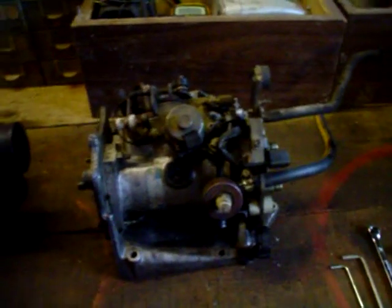The basic concept of tuning is to increase your fueling from your pump and to increase your boost pressure from the turbo. By standard you're probably producing 12 to 13 psi. When you start tuning it, you're probably looking at 18 psi at the most — anything more than that and the heat soak will just slow you down, because with your standard top-mount intercooler airflow isn't the best. So the first thing you want to do is put a boost gauge on the car, because you can't read the pressure otherwise and you're going to blow it out.